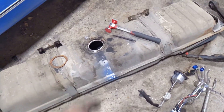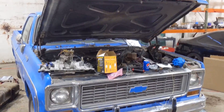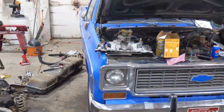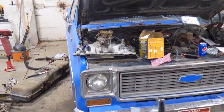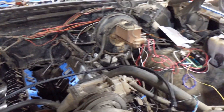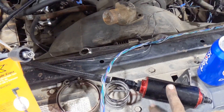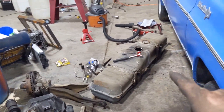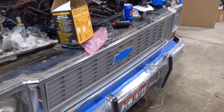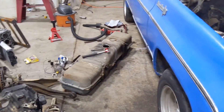I'll catch up with this in a couple days. It just occurred to me that I can still run the positive wire for the fuel pump up to the relay board, so let's do that before we go home. I'll probably do the filter too, but I need to look and see where the lines come through. At least that line is made and ready despite the fuel pump issue.